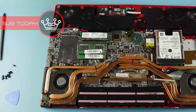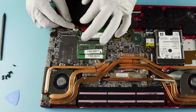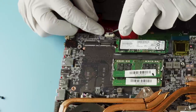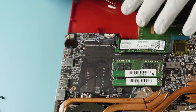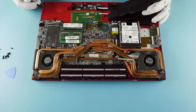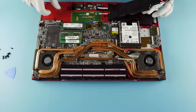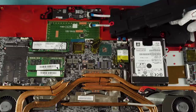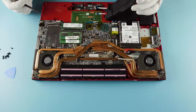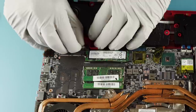If you did need to do anything with your trackpad, it looks like it's as simple as lifting up the speaker and unplugging the connector — kind of a pain to get at. The trackpad on this does not really look like it's going to be easily replaceable. It's actually bonded to the chassis itself. Replacing the pad and having it end up flush afterwards is going to be a huge pain. It'll probably be easier to replace the whole keyboard deck, which will hopefully have the pad pre-installed.